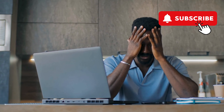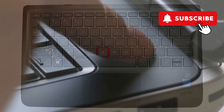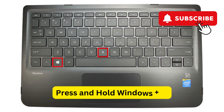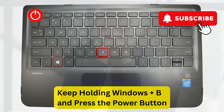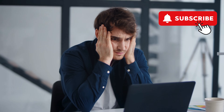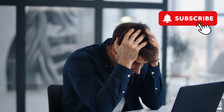If your HP laptop still shows a black screen, press and hold the power button to turn it off again. Now, press and hold the Windows Key and the B Key simultaneously. While holding these keys, press and release the power button. Your laptop should now enter BIOS recovery mode. Wait for it to do its thing and it should turn on normally after that.